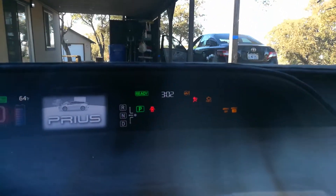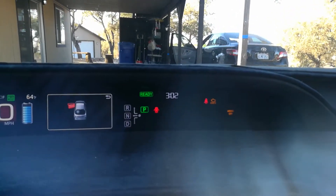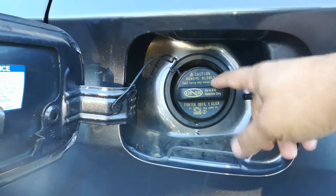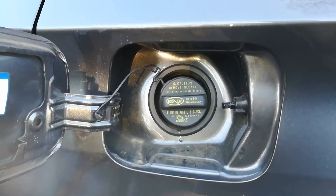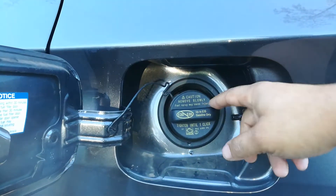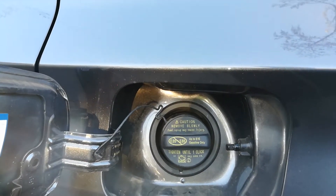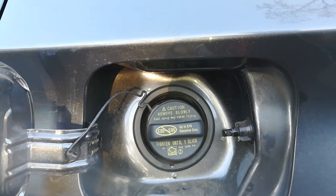My car is on, my check engine light is on. What I did, just to show you guys for video purposes, I left the gas cap loose when I filled it up last time. It took about a day and a half for the computer to detect it, and I threw a check engine light. We put the cap back on tight, and the check engine light still hasn't gone off by itself — it's been a couple of days. It may reset by itself if it corrects the problem, but it doesn't seem like it's working.